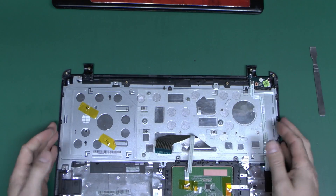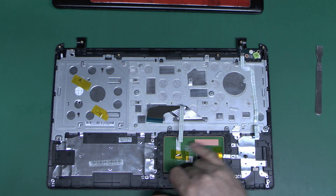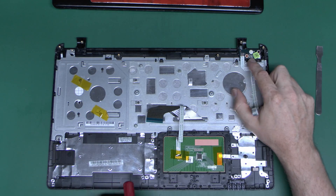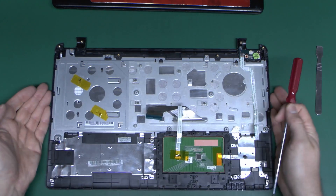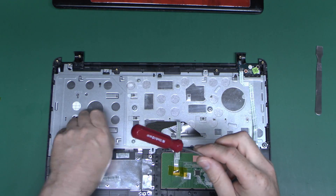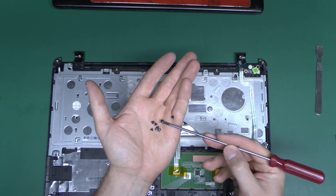Here we have the actual keyboard part itself — now it's time to dismantle this. The keyboard is held with a metal plate which has a considerable number of screws all around it. This here is just a shield where the hard drive things go. This is the back of the touchpad. Those two things there are just buttons which press onto the switches on the motherboard. There's a bit more shielding, and then we've got these two connectors: one goes up to the little board with the power button, and the other is for the touchpad. The keyboard of course is on this flexible piece here. So plenty more screws to take out. That's the screws removed — as you can see, they are ridiculously small.